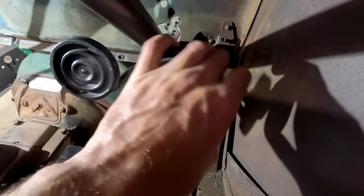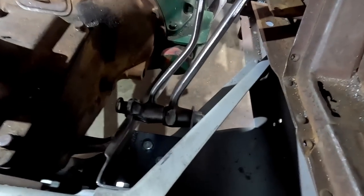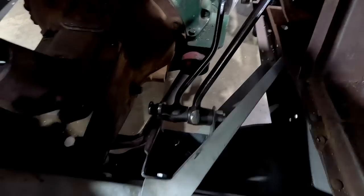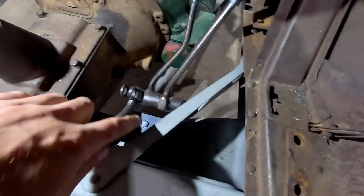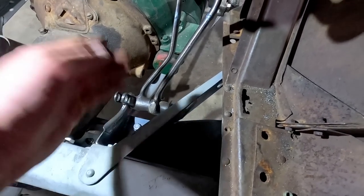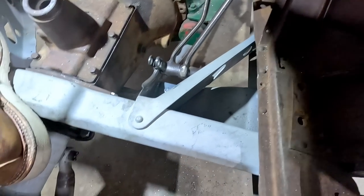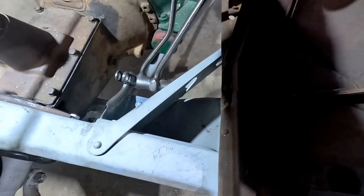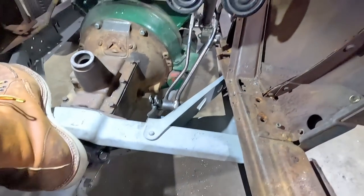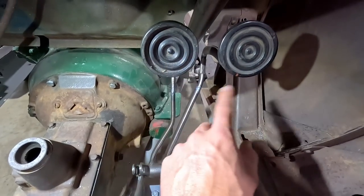And then I'm not going to do anything until I machine the bushings for where they pivot off the box down here. Because where they are mounted, there's a little bit of play in this one. It's tweaked a little bit, the way that the piece is going through. So I need to bring that in. What that's essentially going to do is this whole one is going to come over a fair bit, and then they're going to need tweaking again. So for the meantime, I could probably just leave them the way they are until we have this assembled properly and bolted in.